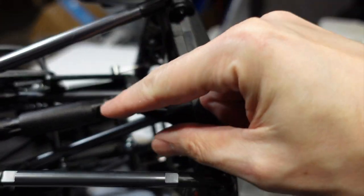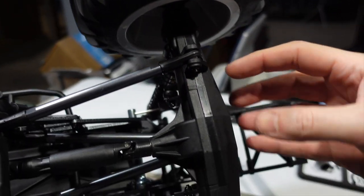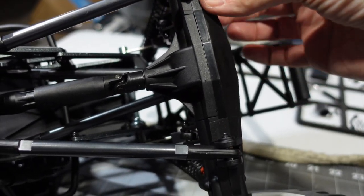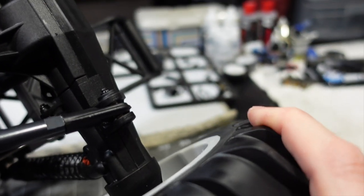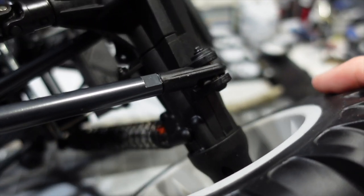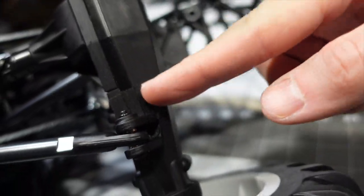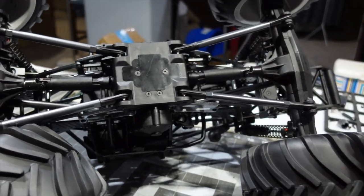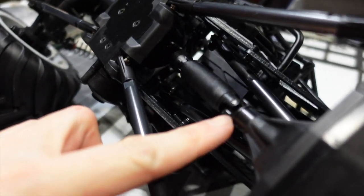The axles actually look quite beefy, but the problem is the multi-piece design. You've got your pumpkin, nice and big in the center, but then there's a split here and a split here, and this is just very lightweight plastic on the outer. If you get hit a few times on the back or front tire, you can see it split right there — that flex ends up cracking through the front or the back of the axles. Something to watch out for.